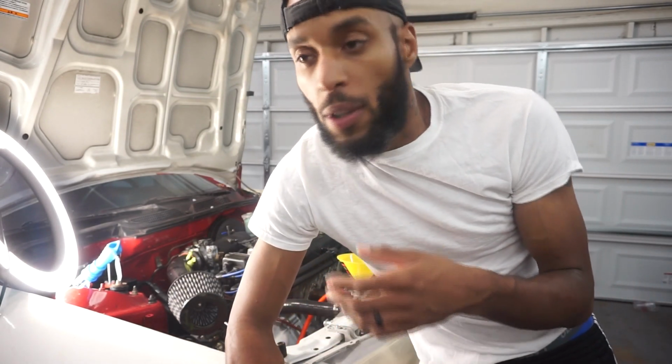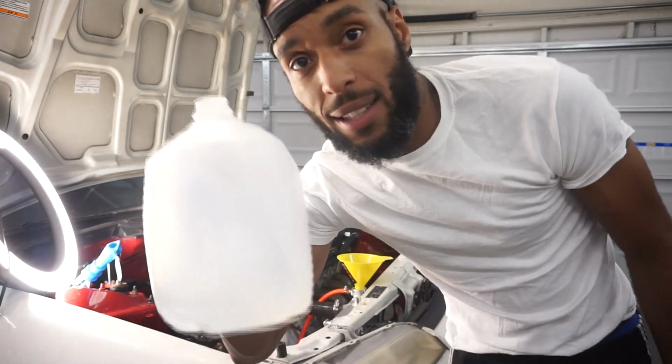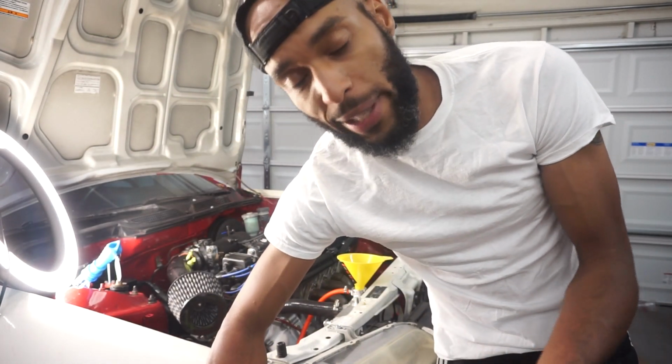get full strength antifreeze, because most of the time it's the same price as the 50-50. And then buy a gallon of water. So say the 50-50 is $11 and the full strength is $11. Well, you buy the full strength and you buy a gallon of water for $2. You got 2 gallons of 50-50 for $13 instead of 2 gallons for $22 or $23.